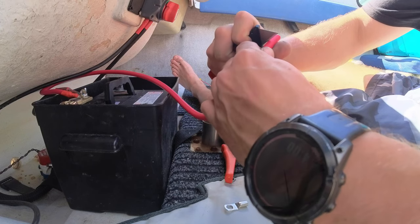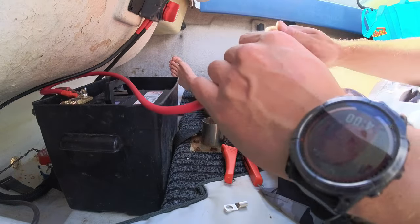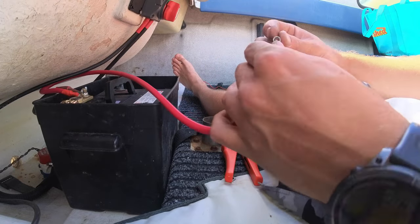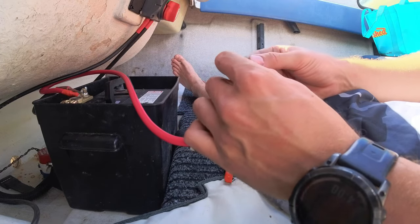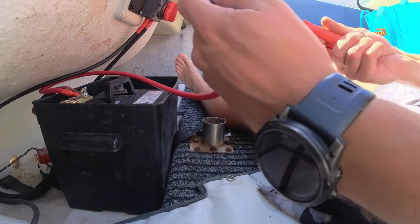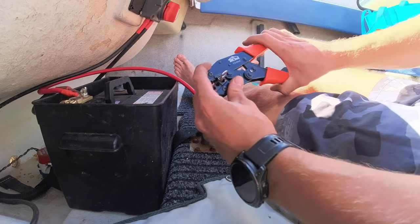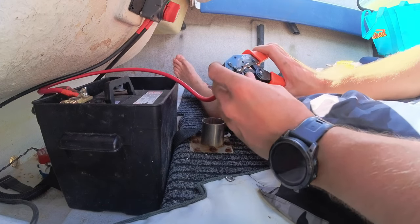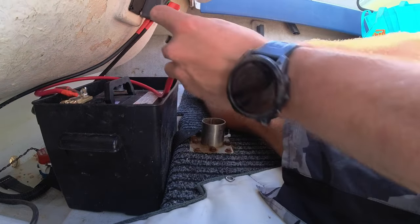You can come a little bit further because you can slide the sheathing down. Just go roughly there, make a mark, and then run a nice sharp blade all the way around the thick core cable — you're not really going to do any damage. Then just break it off like that. It's not zinc-coated which is cheap and nasty, but whatever. Trying not to miss any strands of cable, just slide the terminal right on, get a crimping tool, slide it in — make sure it's nice and tight. Personally I like it to be nice and even with the bottom jaw.